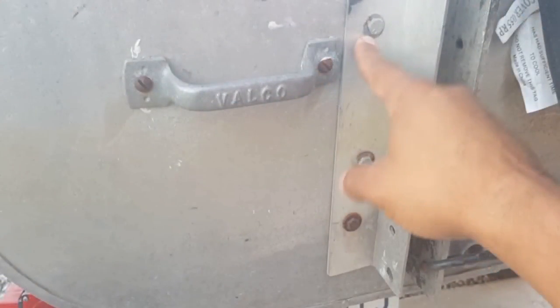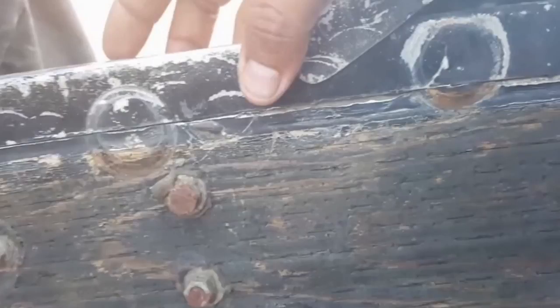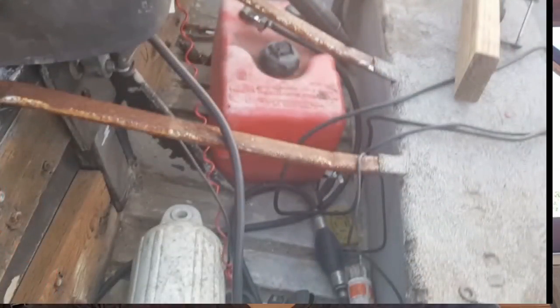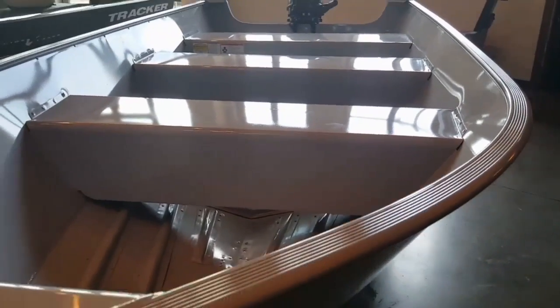I run across a lot of old fishing boats, old bass boats, and john boats that have a lot of bootleg stuff going on. This 14-foot Valco I just converted — I was extremely upset with the transom. I thought somebody had secondhand modified it, but when I went to remove the transom support, those were all stock rivets. The original creators of that boat had stuck in treated plywood which rotted away the back of the transom. Look for Gregor all-welded boats — those things are great. Look for Tracker, Topper, the Lowe series — companies that actually make quality lower-end john boats.